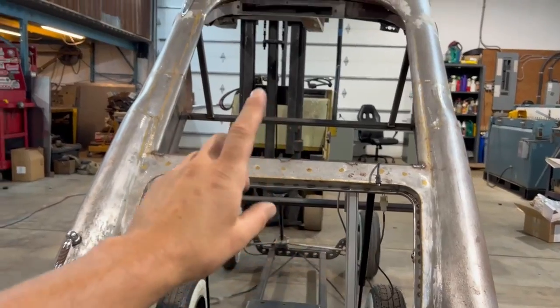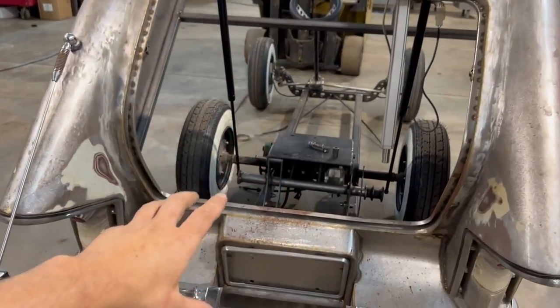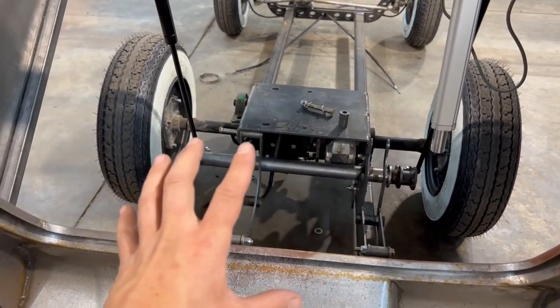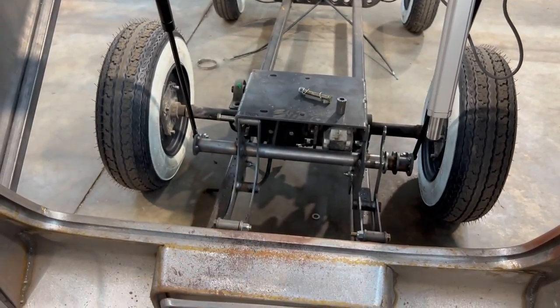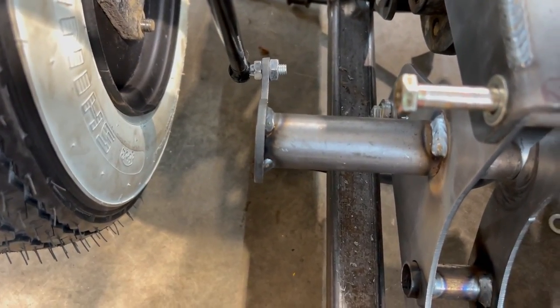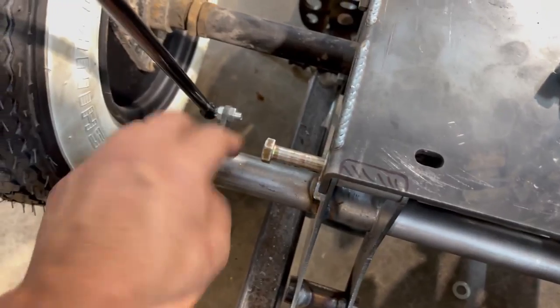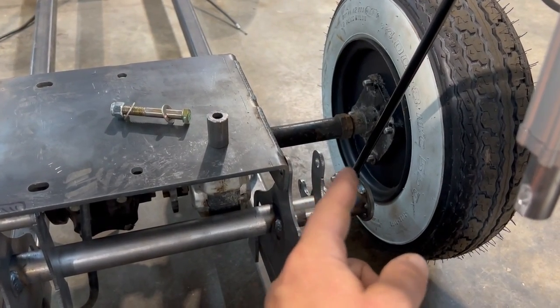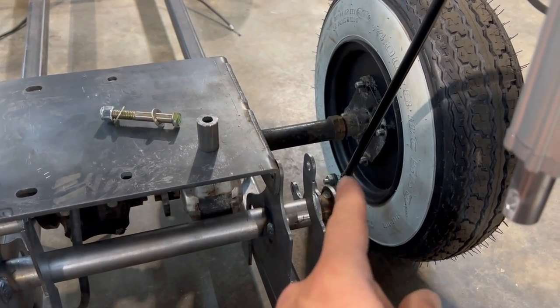Okay, so I'm getting off track here because I was working on those straps, but while everything is out and accessible right now, I want to show you guys as well the gas shocks. They actually don't have enough strength at the end. They're twisting on both of them. The reason being is the design of that tab just doesn't have enough material at the end that matters.